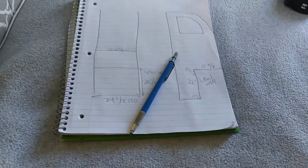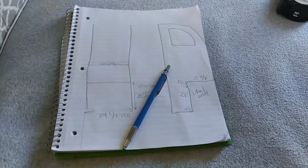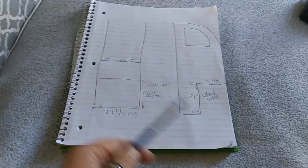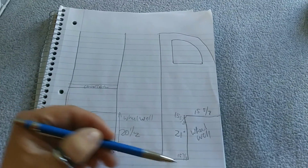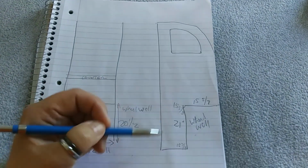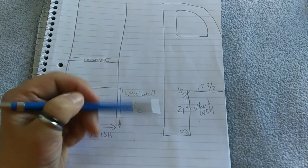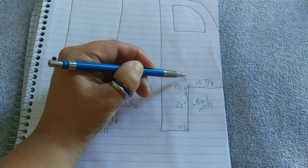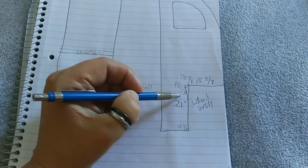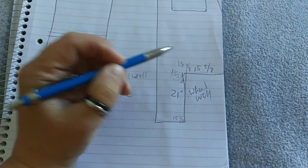Okay, let's see if you guys can follow me with my really great artistic skills. I have tons more skills than this, so this is literally chicken scratch. But so this is our wall, our wheel well. I'm going to make the cut here at 15 7/8, and then I'm going to also make this cut 15 7/8, knowing that I'll probably have to trim it back to 15 5/8.